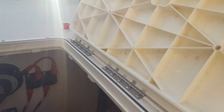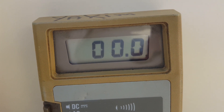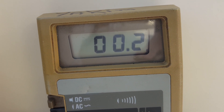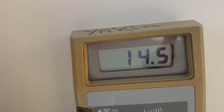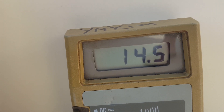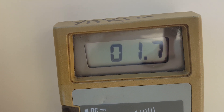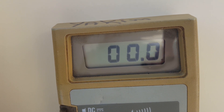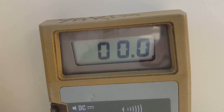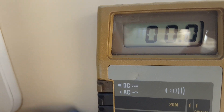Go ahead and show it on there, Vicki. Now I'm on battery number two — keep in mind we're running on number one. Here's battery number two, and what's it doing? 14.5 volts. That means it's being charged, but I'm on battery one — not on both, not on two. Now here's number one, showing 14.4 volts. So what that's showing you is no matter which battery you're on, whether one or two, you're always charging both batteries.